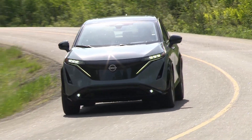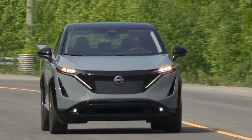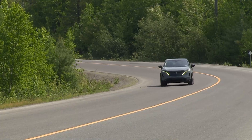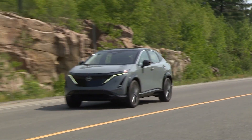Nissan Ariya rolling down the highway here — Nissan's latest all-electric. Cruising at more or less a steady speed, the motors are sending power to the wheels driving me along. But when I slow down, either coasting or braking, each of those spinning wheels becomes a source of free energy. They're spinning fast but not receiving power. So in a moment, the motor becomes a generator, and that generator is driven by those wheels. This is an ongoing and continual process.